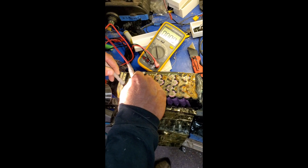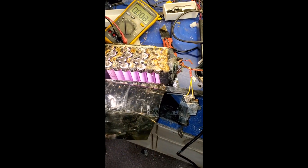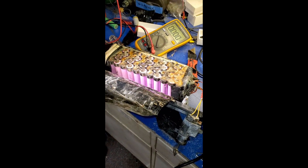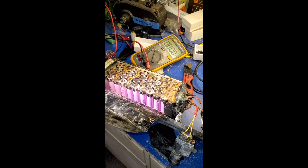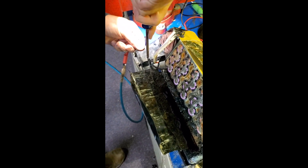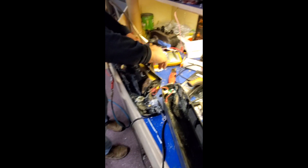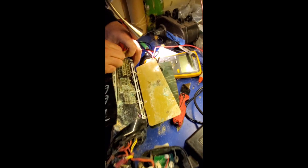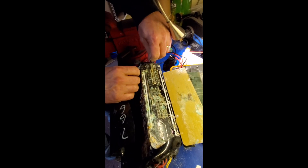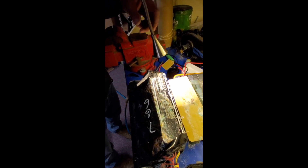So this is not repairable as-is. You could totally rebuild it — you'd want to replace all of these cells at the same time. The carriers are still here, but I think you'd be better off using this battery connector and putting your own battery on it instead. We're on the hunt for the BMS — it's probably in the mess on the other side there. I'd be very surprised if there was no BMS in this thing. There's the BMS — crusty. The BMS is deadass gone. I think someone must have taken this bicycle out of the bottom of a lake. Look how nasty that is. There's no way this battery is going to work. This is an ex-battery — it is bereft of life.